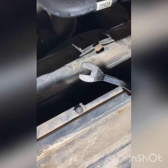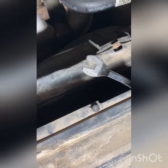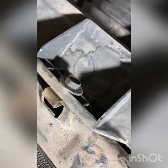So, all right, after I took that metallic bridge off, there's a rubber flap that attaches with these plastic fasteners that fit inside these little holes on your radiator. They go over the top of your radiator and you just take a tool that pops off those plastic fasteners. So I did that. Now, to me, it appears like I gotta take the electric fans off, which are connected by these bolts up on top. So I'll do that next.